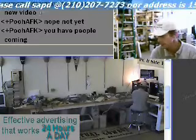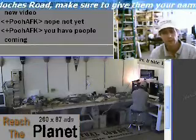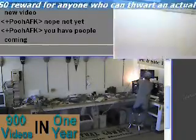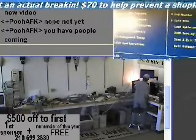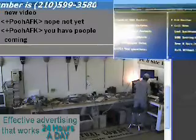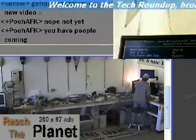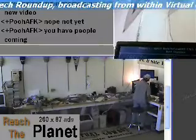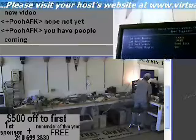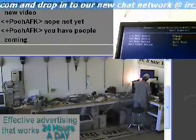The first part of this process, besides burning the disk, is to have the BIOS configuration right. We have this machine fired up and I'm going to switch my KVM switch over so I can turn the camera around and allow it to view the screen. As you tab down through these selections, this line down here changes and you can see it says 'boot sequence' right there very plainly. We're going to hit enter and go down to boot sequence. We've pre-configured this to say floppy, CD-ROM, and then hard disk — first boot device, second boot device, third boot device. We're going to save by hitting F10, click yes, and hit enter.